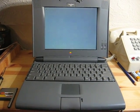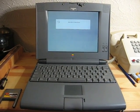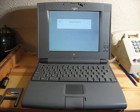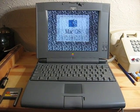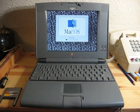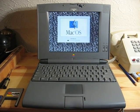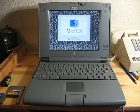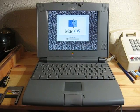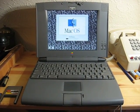In addition to the noise, another problem associated with older SCSI hard drives is they're becoming very difficult to find on the second-hand market, if not nearly impossible. So I would quite like, if I could, to preserve the one in this for the future or for use in another PowerBook which maybe doesn't have a working drive. Since I've discovered, after much experimentation, that you can use a compact flash card, there doesn't seem to be any need to keep the internal hard drive in.